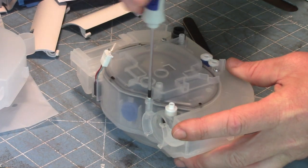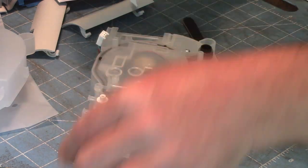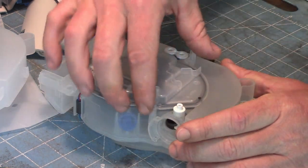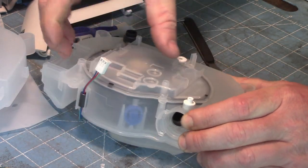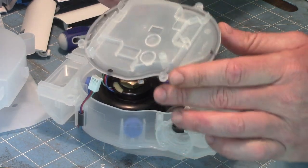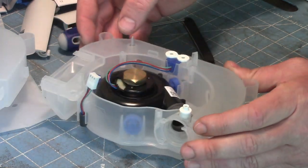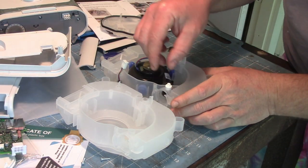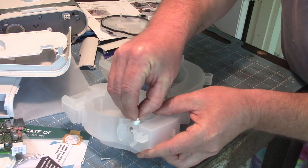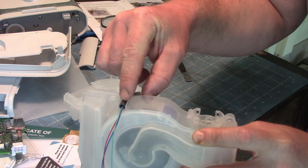Let's go ahead and take out the screws that hold the top cover on — there's one, two, three. With those four screws removed, let's get this thing off. Here's the CPAP fan. I'm going to go ahead and start swapping things. This little rubber needs to come over here. Look at the routing of this plug — the little isolator goes through a piece of plastic, the wire goes underneath and around the back. We're going to simulate that.